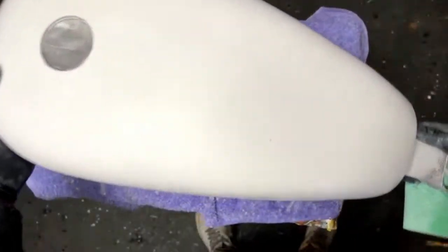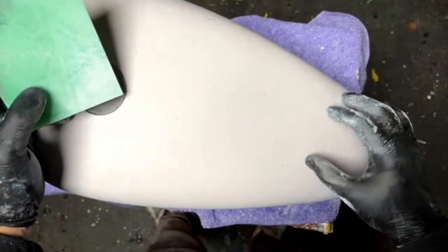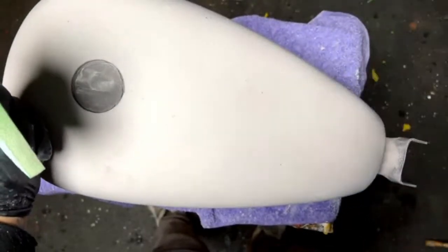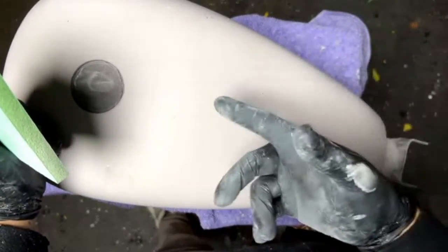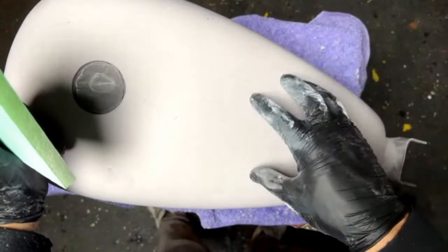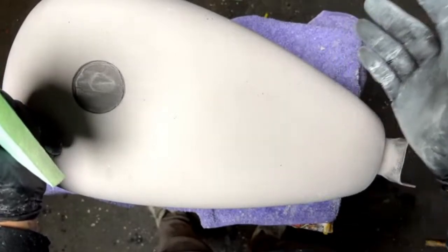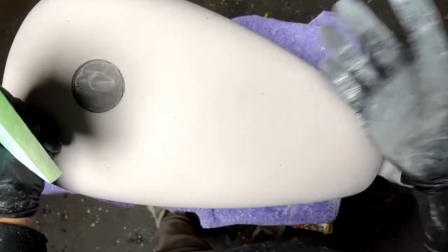The paint's going, now that this is dried and been sanded, the paint is counting on the scratches that we're putting into the surface of the primer here to be able to adhere. It's called a mechanical adhesion. That's one of the two ways that I know of that paint sticks. It's either going to stick mechanically, like we have here, to a scratch, or it's going to attach chemically. The primer itself, however it's formulated, has stuff in it formulated to chemically adhere to the metal. But from this point on, whatever we spray on there is not going to chemically adhere to that.